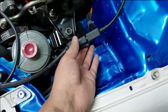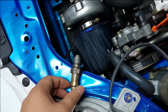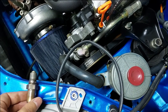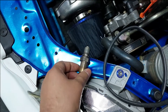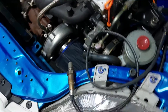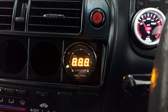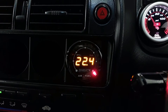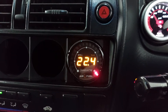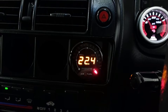The sensor is just here — that piece of wire is coming out under the battery tray. It's plugged into the sensor. I took a little plastic cap off because you need to calibrate it now, and for that it needs to be in open air, so I'm just going to lay it here. This thing does have a heating element so probably don't put it on something plastic. I'll turn the gauge on again and it should calibrate. Once it's calibrated we'll take that one out, put this one in, and that should be it. Okay, the sensor is now connected and it should be in calibration mode. It's calibrating — there we go, it's calibrated. So I'm going to key it off, install it in the exhaust pipe, and connect everything up. Just don't power up the gauge while the sensor is not connected, otherwise it'll trigger calibration mode again.